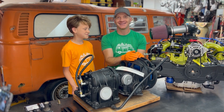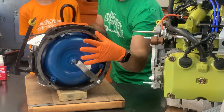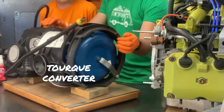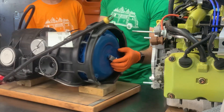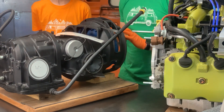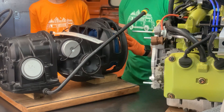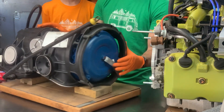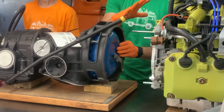This is from German Transaxle. What you can see here is the torque converter — this is a brand new RV stall torque converter, heavy duty version. If you have a torque converter and it's off, you want to make sure you seat it fully and make sure it stays seated before you try to mount anything. You'll be in nightmare mode if you try to mount things together without this fully seated on the transmission.